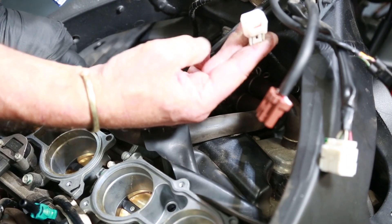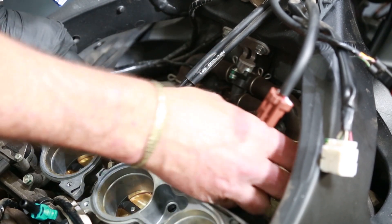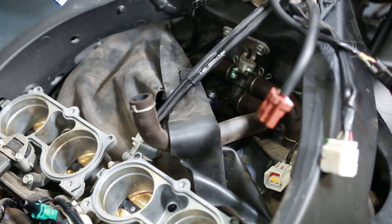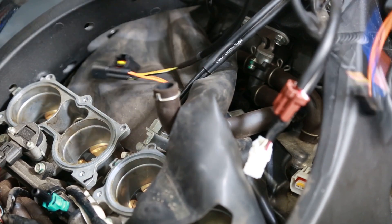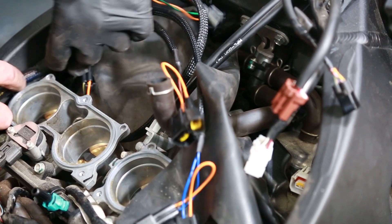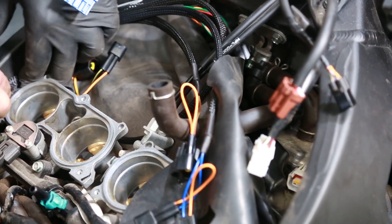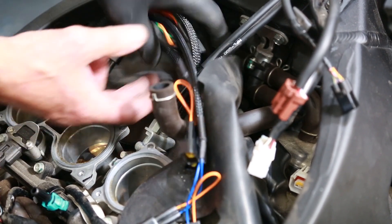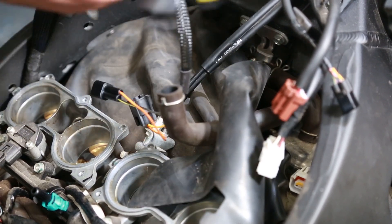There is the plug I've just taken off — each one has a little two-pin plug on it like that. We're going to take those off, connect our harness into the coil sticks, and then wire it back into these as well, so it will loop back. The harness is routed along the side of the frame here following the rest of the harness. I'm going to tuck this one down in beside the throttle body where it fits just nicely.